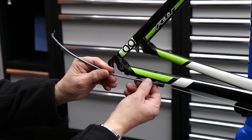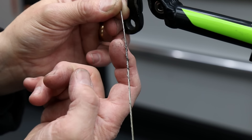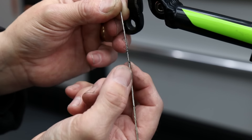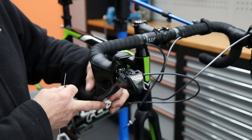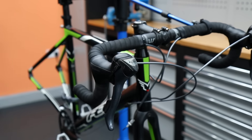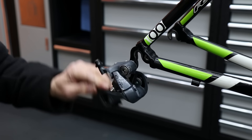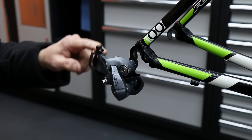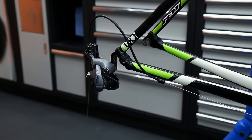This was probably another reason the customer replaced that cassette — the rear derailleur cable had begun to fray at the pinch bolt. It had run itself up through the outer, coiled up to the point where it was actually out of the outer at the other end, causing problems with his shifting. We're swapping that out for one of our super slick stainless steel cables.